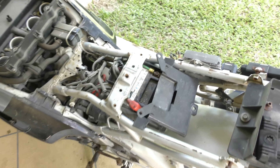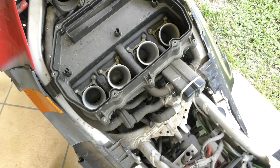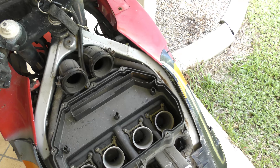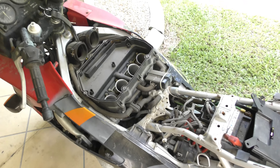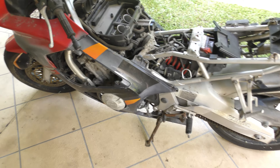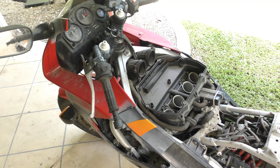Today I'm going to jump the gun and install the new battery, put a teaspoon of fuel down each one of the cylinder bores, and crank it over to see if I hear any backfiring. I do know the bike cranks over. I'm also going to tape up those venturis, high-pressure wash the bike down, and remove the fairings.